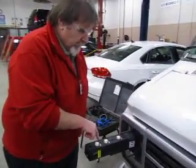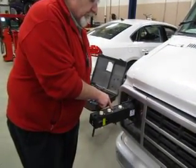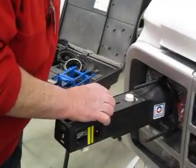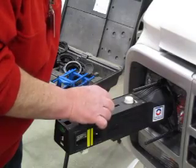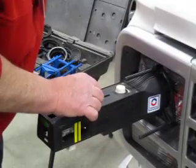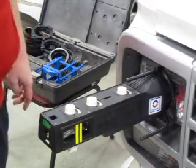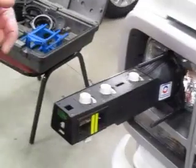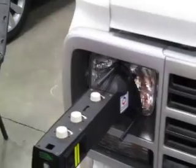I'm going to first turn the knob here on my vertical until I get my level vial between the two lines. And I'm bringing that in now. Remember that the level doesn't move immediately. If it doesn't move when you turn it about 5 inches or so to the right, try it left and see if it begins to move.